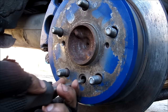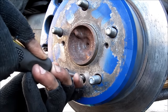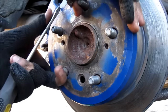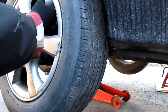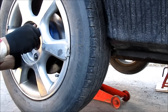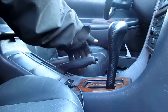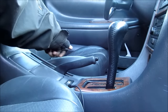I'm going to use a screwdriver and put it in here to turn the star wheel up or down to adjust the parking brake. Make sure the wheel can still move. Finally, give the parking brake a few tries to allow the shoes to reseat, then take the vehicle for a test drive and make sure it works properly.